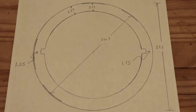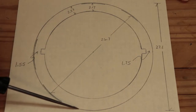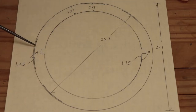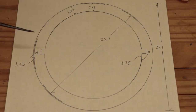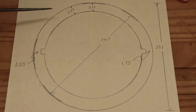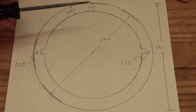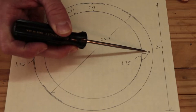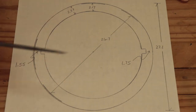I know this might be a really really bad idea, but let me explain what we've got. The current seat post diameter all the way across is 27.1 millimeters. What I need to get it down to is 26.7 — and this is drawn absolutely to scale so you can see how much needs to come off. Essentially 0.2 millimeters needs to come off the whole circumference, and I'm only going to remove it from the portion that's going to be inserted inside the seat tube. I was actually surprised — it seems like it's almost overbuilt. The wall thickness is 2.37 millimeters and once I reduce it down it'll be 2.17. The only potential weak parts are where the groove is, and right now the thickness there is the same as the original seat post on the bike.